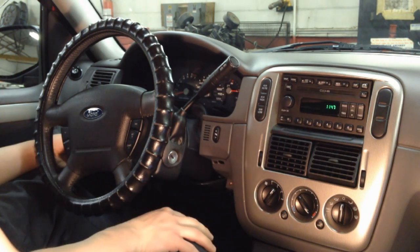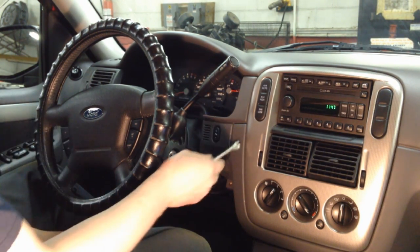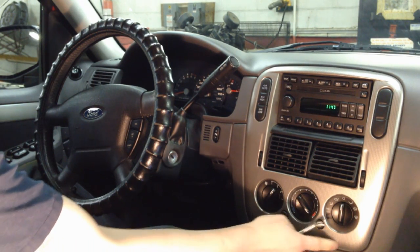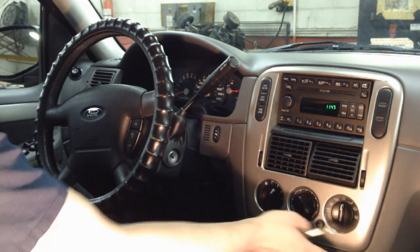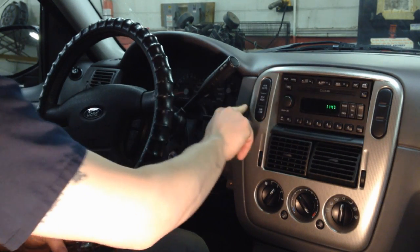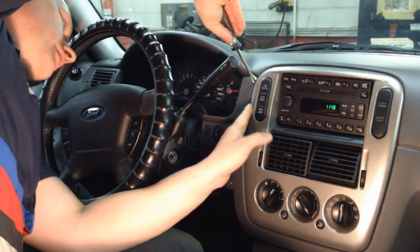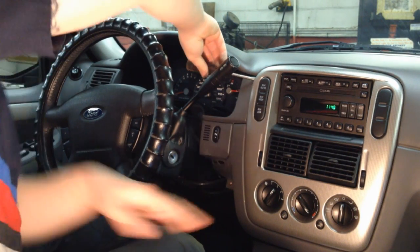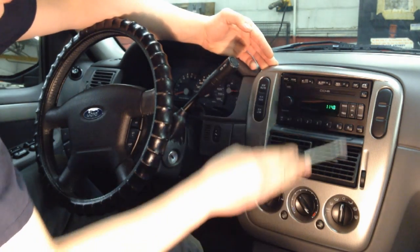The push retainers are really, really tight. If you start prying down here with any kind of tool, you're going to start getting indent marks — this is a soft foam with a hardened overlay for the texture, and it goes all the way around except for right here. So we're going to pry up here; that seems to be the best spot. Once that top part pops, we can start working it all the way around.